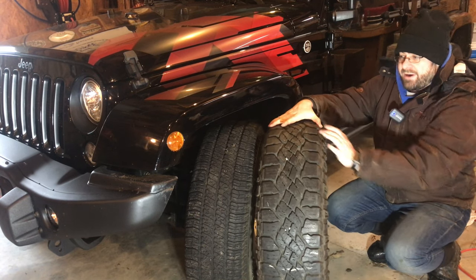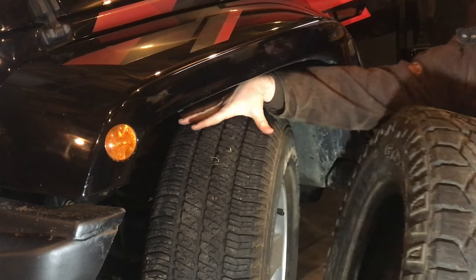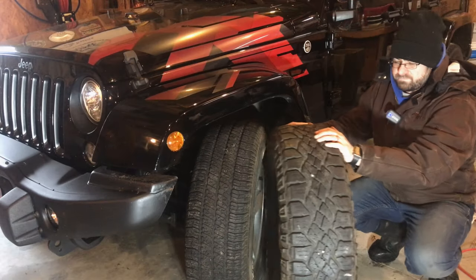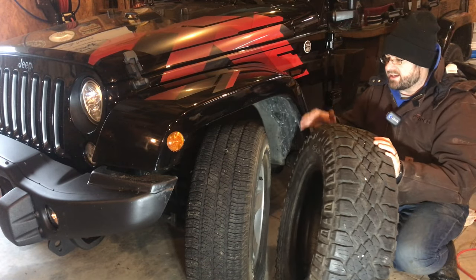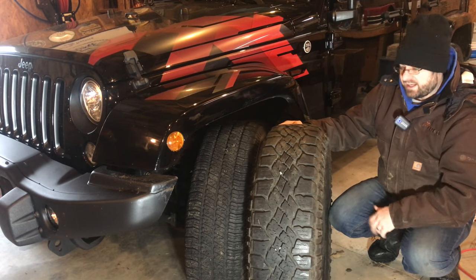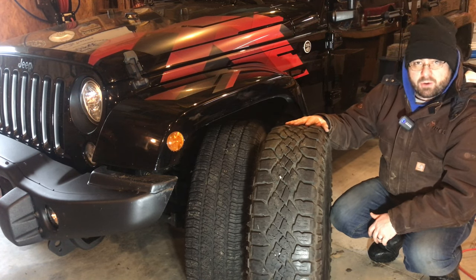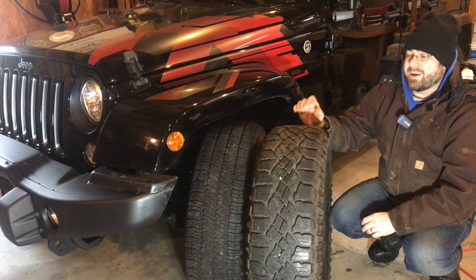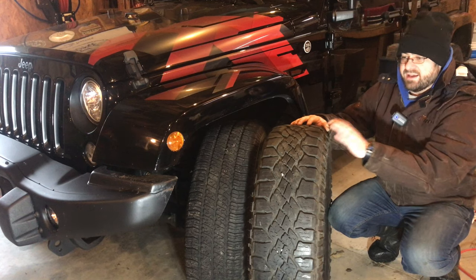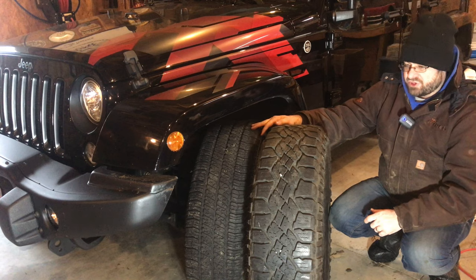Some people ask: would you run two of these just in the back and leave two Wrangler SRAs on the front? No. You'd always want to make sure you run four of the same tires because even though they're the same size according to the sidewall, they're a little different in dimensions. These Duratracs are a little bit taller and actually a little narrower. I can get my hand all the way across their tread pattern, while the SRAs are a little wider. Also, these are a three-peak mountain snowflake rated mud and snow tire, perfect for our winters here in Northwest Pennsylvania. I can't wait to see the brand new ones with 18/32nds of tread.